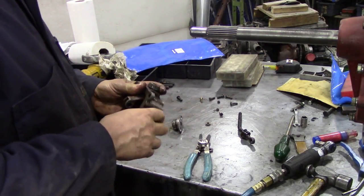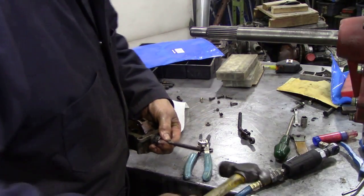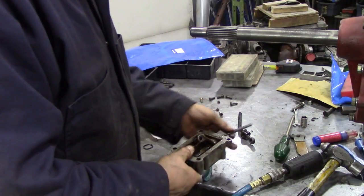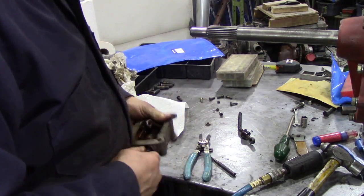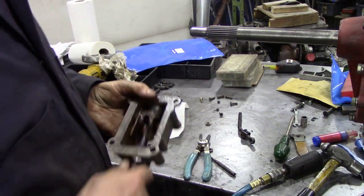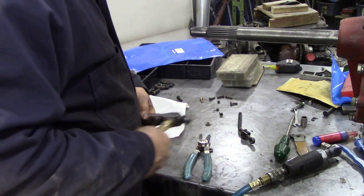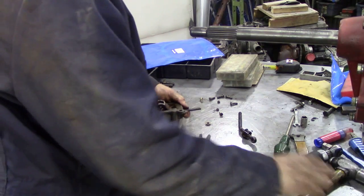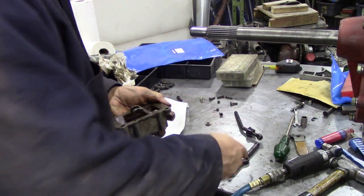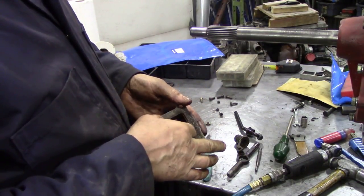Now all we've got to do is knock this shaft out of here. See if we can pop this through. There we go - shaft comes out the end. It's quite easy to remember which way they go around, these shafts, because one's got a hole in it and the hole goes through this fork here - so that's kind of easy. Just a couple more taps and that'll come out. There we go, this comes out, and this little spring clip comes off there because I've already taken the bolts out.